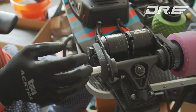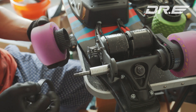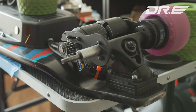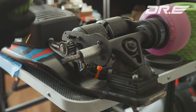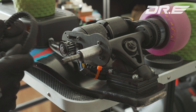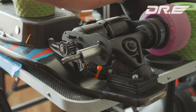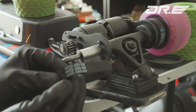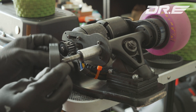I'm going to take this out. As you can see, the pulley size is small and I've had my motor mounts literally on the ends. You can see my motor mounts are all the way here, and if my pulley size is bigger, these belts are not going to work. I ordered bigger belts — this is actually the wrong pulley size at only 12mm, and I need the full power of 15mm. So I ordered some slightly longer ones: instead of the 255M I had, I've got these 265M's.